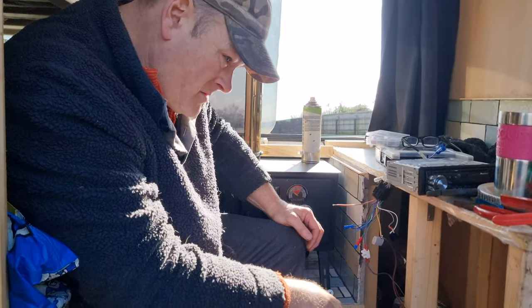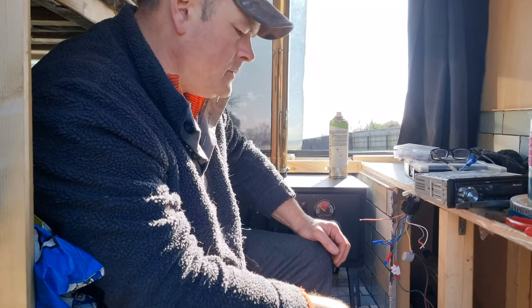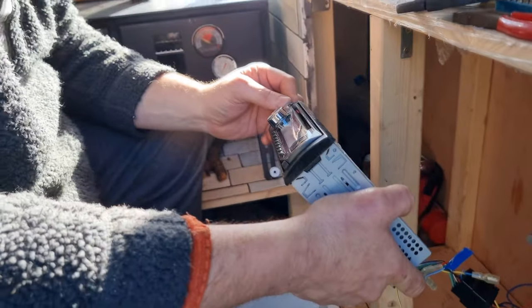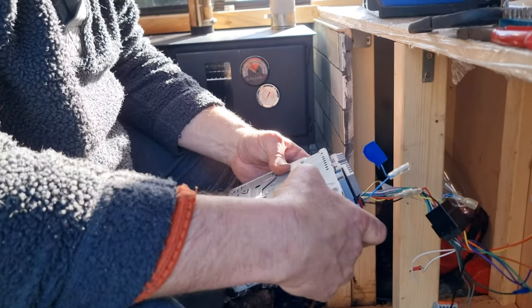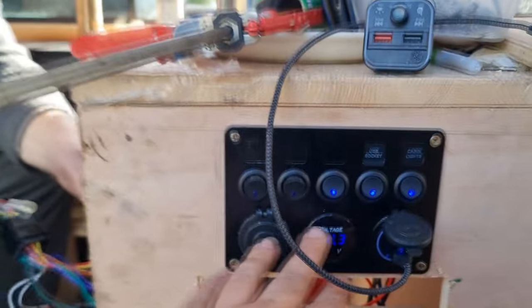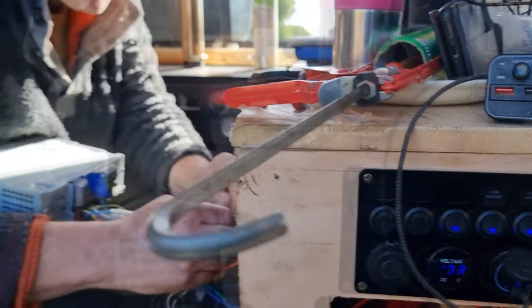Explain what you're doing. I'm fitting the stereo at the moment. The wiring's getting quite elaborate underneath here — I can't really get down far enough, I've got a bad back and a bad neck. I need a constant power there, don't we? I wonder if that orange is the constant. Once you set it up — I don't understand, it's constantly on now. No, there's a constant as well. The orange — I think I've got a little remote control switch here. It should be a constant so when you set the stereo up it doesn't lose memory. Oh yeah.